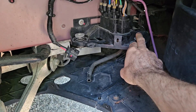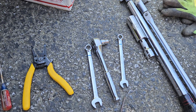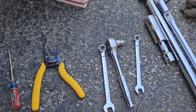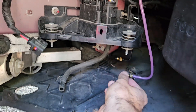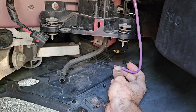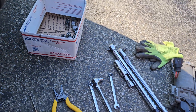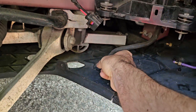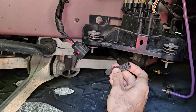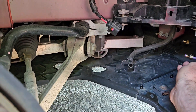Tools are pretty simple: you've got 10-millimeter bolts holding on the top, so a 10-millimeter socket. You also need a number 10 and a number 12 open-ended wrench to get the airlines off — there's not a whole lot of room in there, so you're doing eighth-of-turns unless you have a much smaller wrench. Some sort of pliers for pulling off the air inlet tube that goes up to the air filter, and then two wire harnesses.